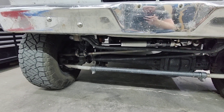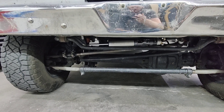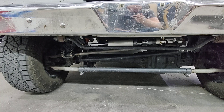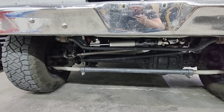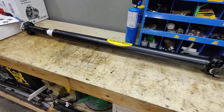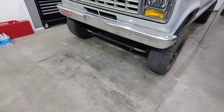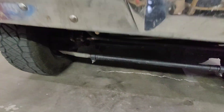What I lack right now is I have to re-gear this front axle. The rear axle I re-geared to a 4.30 gear ratio, and this front axle has 3.30s in it. I do have the gears, and I just have to put them in. I actually have the gears and the new front driveshaft waiting to go in. I've got a Detroit TrueTrac and gears there — I just have to do it, and then this thing will actually be four-wheel drive.